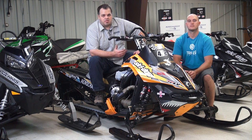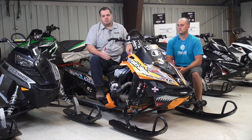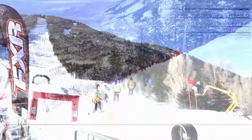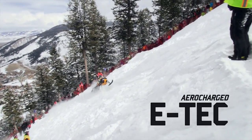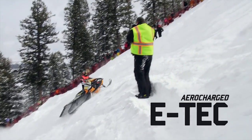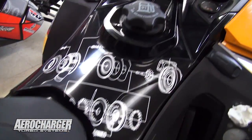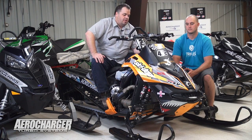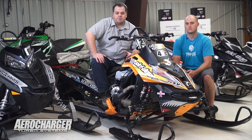Having 13 to 15 sleds in our race and R&D effort allows us to do different things. This is Carl Kooster's sled from Jackson Hole last year. This was really a design intent for the 2013-2014 consumer kit, and what you do receive in your kit this year is damn near exactly as this sled sits here today. This has an air-to-snow intercooler, O2 gauge, and boost gauge. This is creating the best power band we possibly could. Even the clutching and gearing in this is now going to be included with your kit.